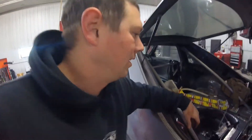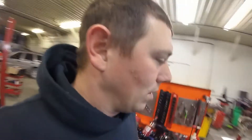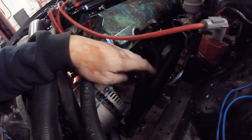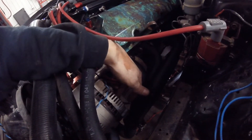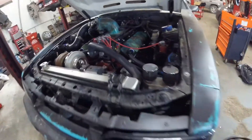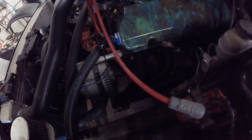There's a bunch of wiring diagrams out there. The last thing we've got to do for the alternator cutoff is wire it up on the backside of the alternator. We've got the wires run underneath - I've got to zip tie them up out of the way, connect to the alternator, and then we'll test that and make sure it shuts off the whole car. Battery's hooked up. We've got the alternator kill switch wired up, that wire's out of the way. Now we're going to test it.